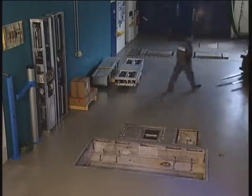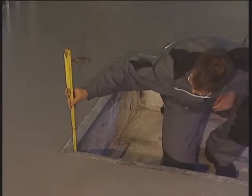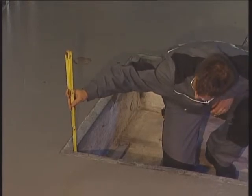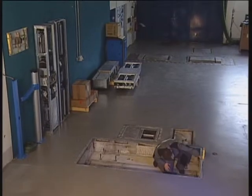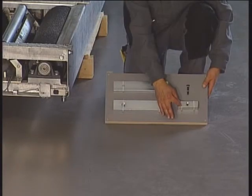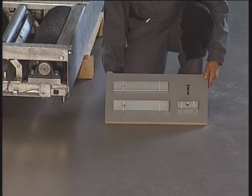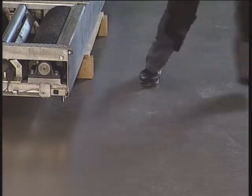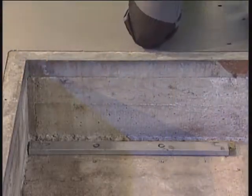Check the pit dimensions before installing the SL680 Beissbarth test lane. If they satisfy the dimensions that are specified in the planning folder, the roller test bench, the suspension test unit and the side slip tester can be installed. Due to the low construction height of the roller sets of the BD600 series, the height adjustment will make it easy to adapt the unit to existing inspection pits.